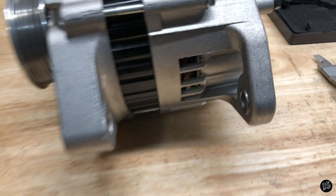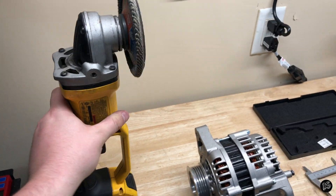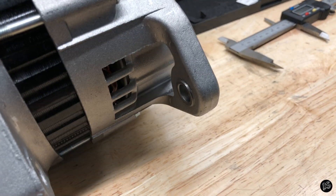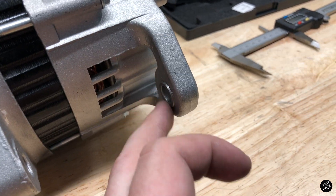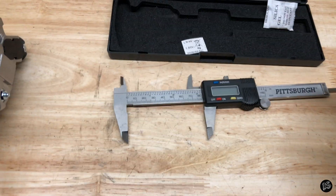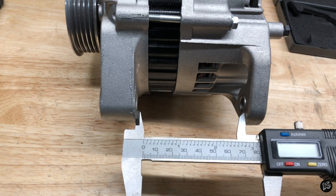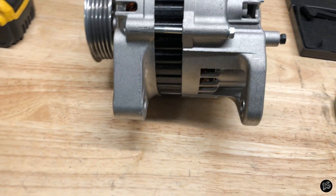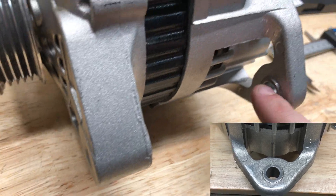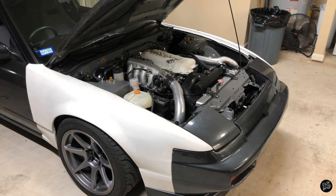Normally they have a steel sleeve that sits in here, and that steel sleeve you can kind of push back a little bit and then get it onto the bracket — when you tighten it down, it clamps down. But this is a cast piece, so you can't move it in and out at all. So for S14 SR guys, you're going to have to take a flap disc or a file or something like that and just take a little bit of this off. You don't want to take all of it off, but just a little bit. I measured it at 80 millimeters, and basically it ain't going to go on — so you've got to clearance this just a little bit for that to work.